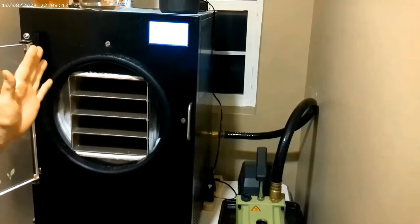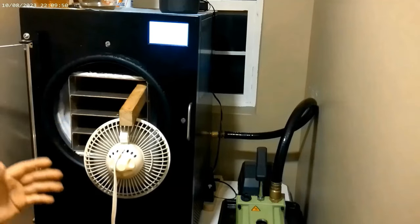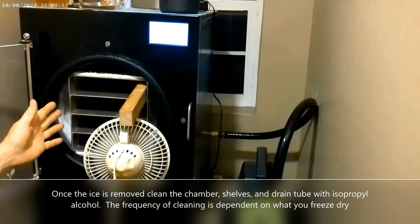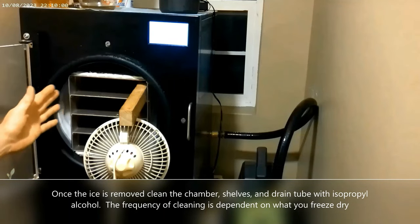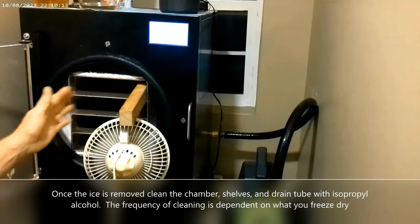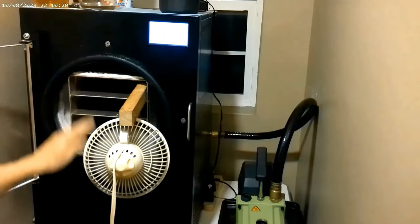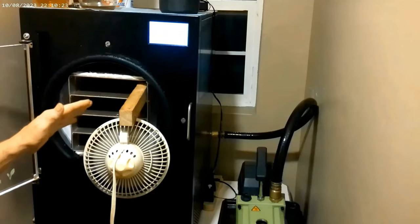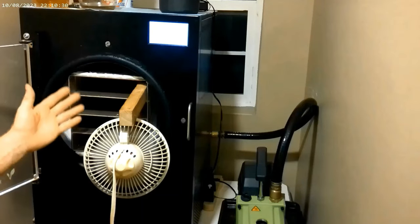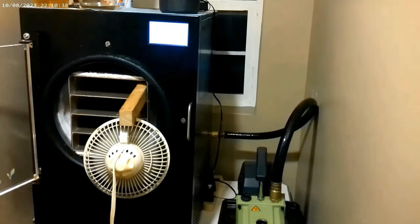As far as the freeze dryer itself, I'm going to put my fan in here, turn that on, and allow the warm air of the house to circulate throughout the chamber and melt all the ice inside. All that ice will go through the drain tube into a five-gallon bucket underneath. The constant air of the fan circulating throughout the chamber, shelves, and insulation boards will dry the chamber out. The drier the chamber, the less likelihood of any bacteria growth. It's what I've been doing for the last three years, and this arrangement stays in place until I'm ready to do my next batch.